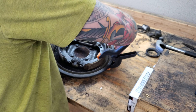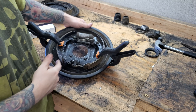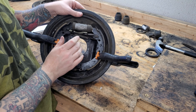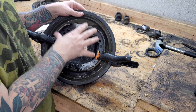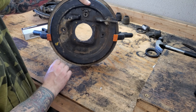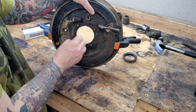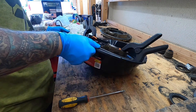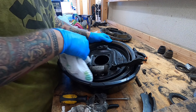During the process of getting the rear wheel bearing off the axle shaft I ended up shearing both the pins that hold the brake shoes on, so I decided to just get a whole new brake hardware kit. I also drilled out the center part to three inches, so now we can disassemble the rear axle and take the rear axle shafts off without disassembling any of the rear brake components — that's a pretty big deal. I couldn't fit this in the press so I did it by hand. It came out pretty good — I just need to smooth these out, throw a tiny bit of paint on after I clean them up, and get my new brake parts on.